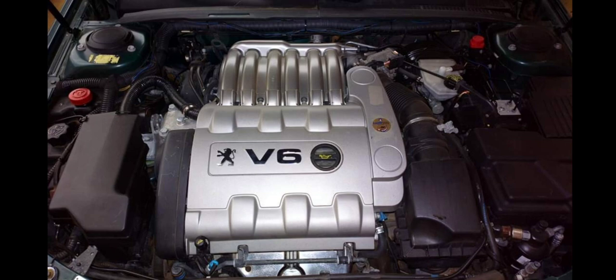Now, the reason why I pointed out that you need to understand the engine first is to know which part of the engine to cover before you start washing it. For example, on EW engines, basically almost all of them, around the thermostat housing there is a gap or space between the intake camshaft side chamber and the exhaust camshaft chamber. That is the gap where the spark plugs and the ignition coil are located, more like the ignition coil chamber.